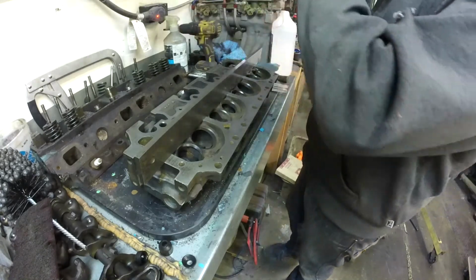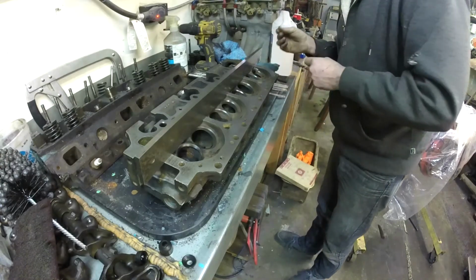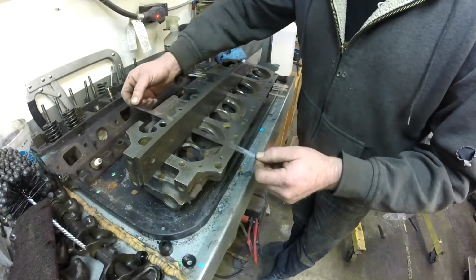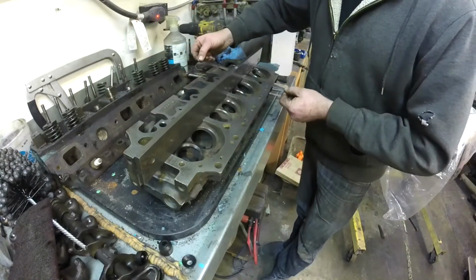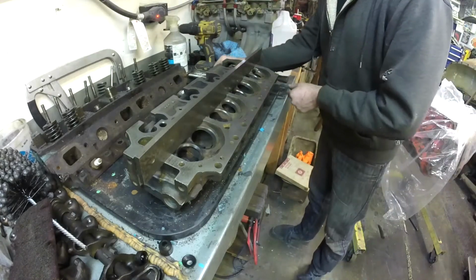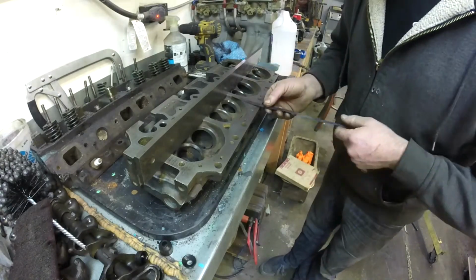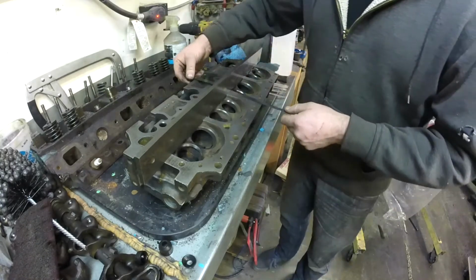Okay, so knowing that 1.5 thou is no good, we're gonna run right up to 2 thou. Same thing, I can fit 2 thou in. Okay, I was expecting at least 2 thou. Run it across. Yeah. All right, we're gonna have to go bigger. And one at a time. We're not gonna just jump up a few thou and try to expect that we're gonna get any kind of regular amount. All right, three thou,